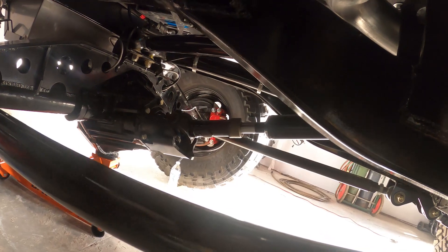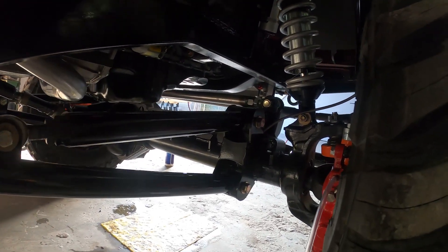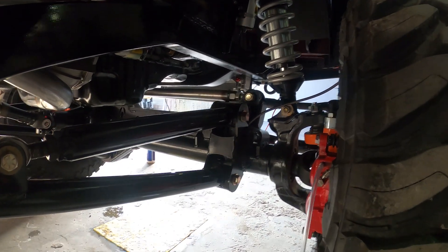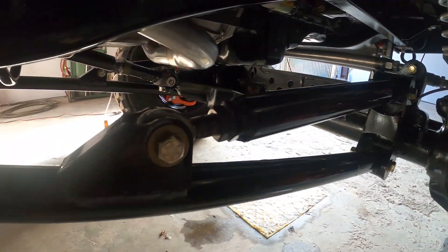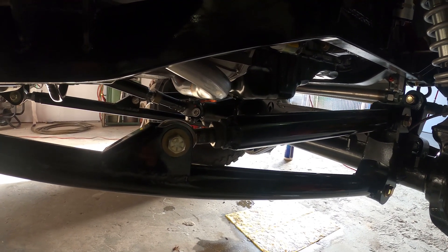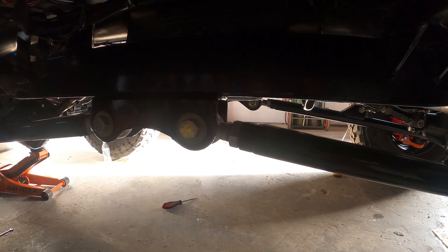The combination of upper and lower links we can use to tilt the axle forward and back. The majority of the time that's only used to make sure you get your proper driveline angle and limit any binding or vibrations. The front's a little bit different because there's only a joint on one end, so we actually have to unbolt it to adjust - which we're not doing today. These are perfectly fine because it's just a bushing on the axle side. This one is again like the rear, just for moving the front axle forward and back.